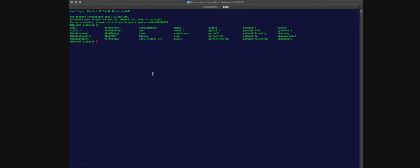Now, how do I get to this new image and this new operating system installed on the SD card? Well, you need to figure out which IP address your router will assign to the card. So you have several options. You go to your router or your access point, whatever, and check if there is a list of devices, and in that list an IP address should be assigned to that particular device. Or you get one of those IP scanner software. I use a software called Angry IP Scanner, and there are several ones. I'm on a Mac, so maybe it's available for Windows or Linux, depending on which operating system you're using.